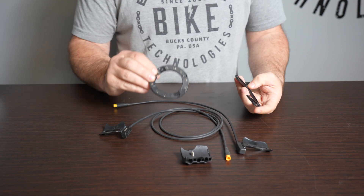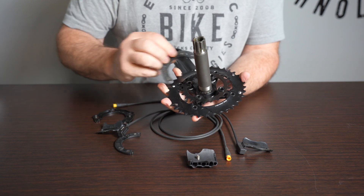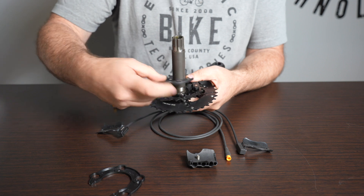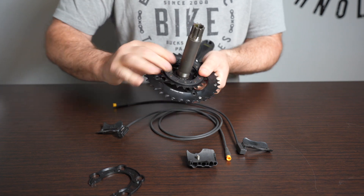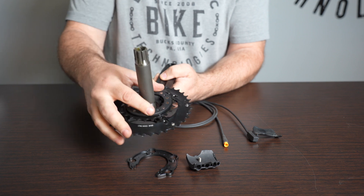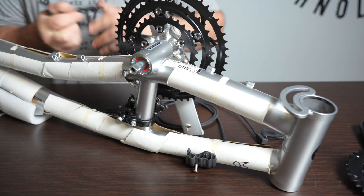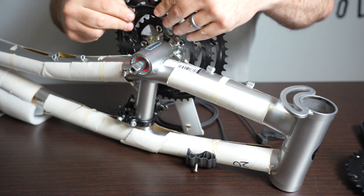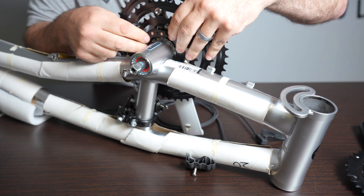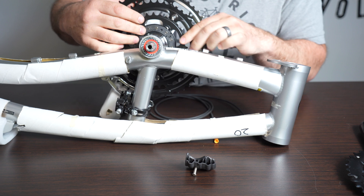Or a five-bolt 74 BCD. Here's an example of a four-bolt — you can see there are little notches already cut out on the magnet, so you don't need the retaining clip; the grooves just go right over the bolts. It adheres to the chain ring, and in most cases the magnetism will hold it in place, but you might want to secure it with some zip ties or even some glue. If you have a five-bolt chain ring, you'll need to use the adapter plate — make sure the cutouts go over the bolts and line up your notches. You might want to use some glue or zip ties to hold it in place, though the magnets will hold it to the chain ring.